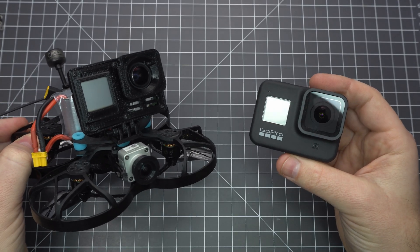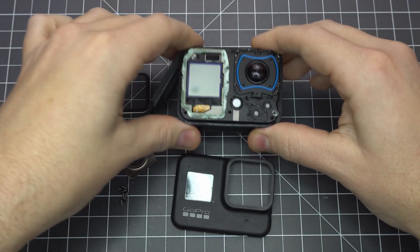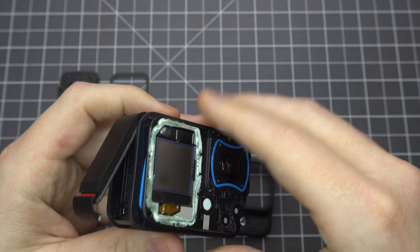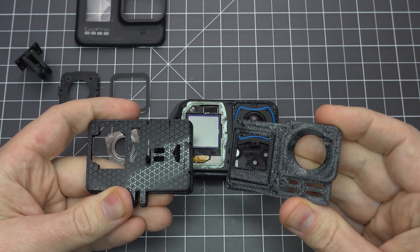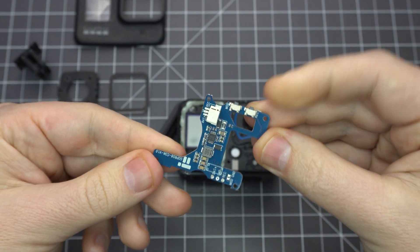In this video, I'm going to strip a 124 gram GoPro Hero 8 down to 30 grams to be carried by a micro drone. I'd like to thank TronixFix for generously donating his broken Hero 8 — he got as far as removing the front cover and I'm going to take it from here. Look for a link to his video in the description. We'll be replacing the shell with this 3D printed case made by iFlight and we'll piggyback this board to add buttons and provide power from the flight battery.